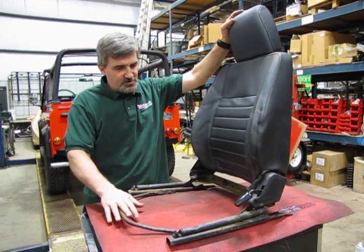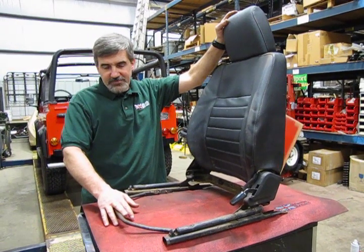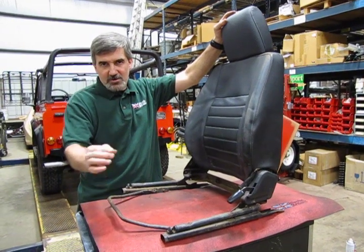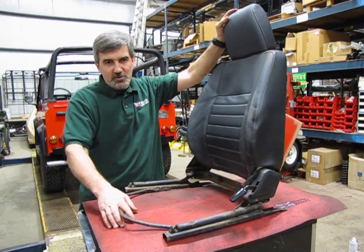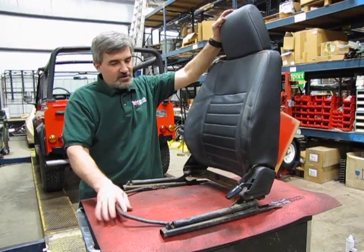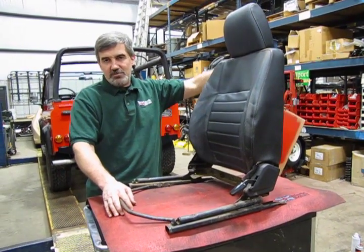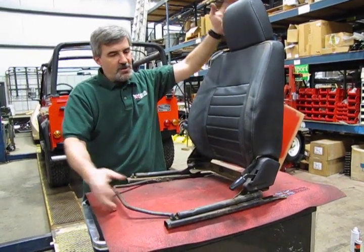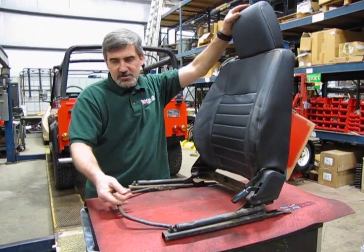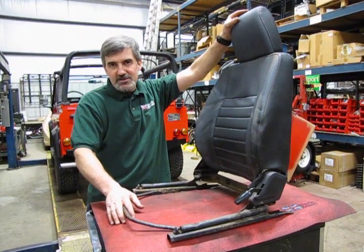What we have is the driver's seat already removed from the Defender. It's essentially an easy job — four bolts, two in the front, two in the back. They bolt into nutserts locked into the body of the vehicle, so you can just take it out with a ratchet and a socket. Take your two out of the front, slide the seat forward, bring the back to the full forward position. The two bolts in the back are very easy to access. Pick the whole seat up and pull it out. The bottom of the seat is just a pop-out situation, so we put that to the side and we'll get to it later.